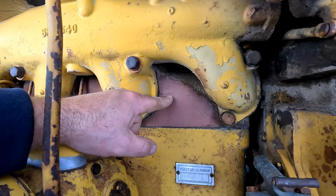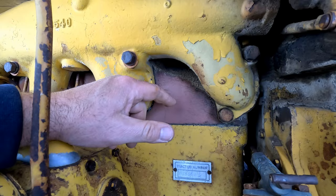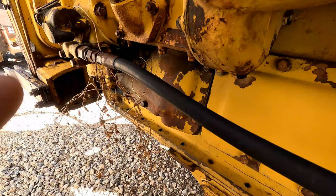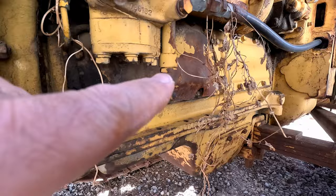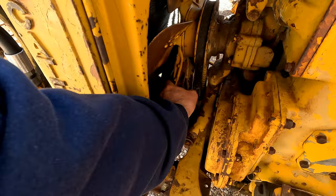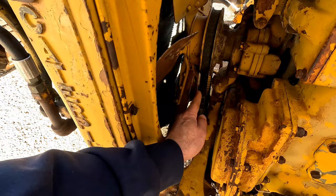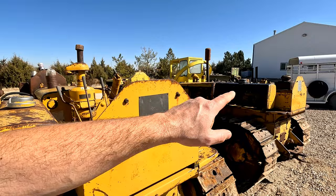By checking the numerical code, we could tell they were replacement heads. The one on our 7J that we're putting together — actually we're using the original 4G head, but the 7J motor had a replacement head. Looks to me like something attempted to poke through the side of this block down here — you can see right there, it's kind of pushed out. So this engine may have had a problem. In fact, I would wager to bet that this has something to do with that bearing cap that we found in the toolbox. The water pump is free, but the engine is not — I have not been able to get this to turn. When I see carnage like that on the side of an engine, I really want to take it apart and see what went wrong. Is it a candidate for a rebuild? I don't think so. I do find it interesting that this being an early 7U, it still carried over a lot of things from the earlier generations of D4s that definitely changed when we get to that one.